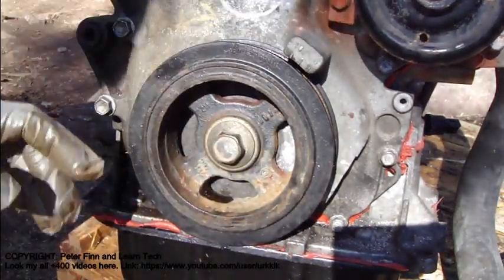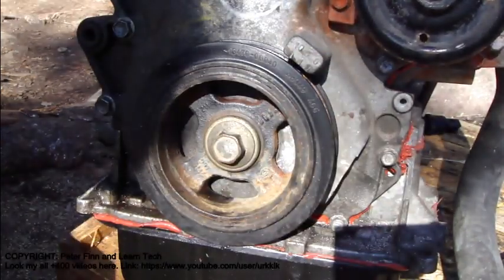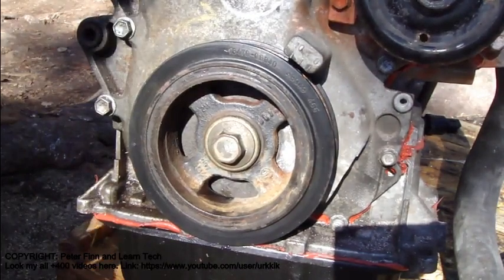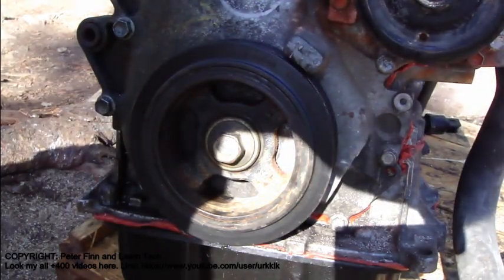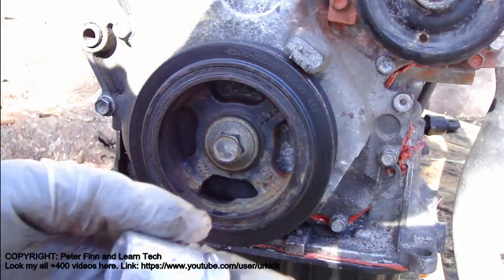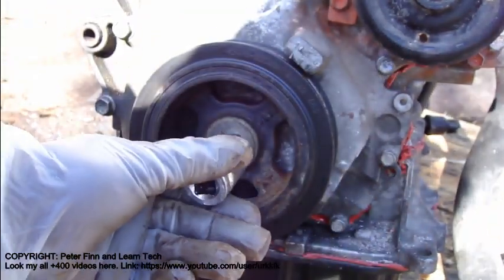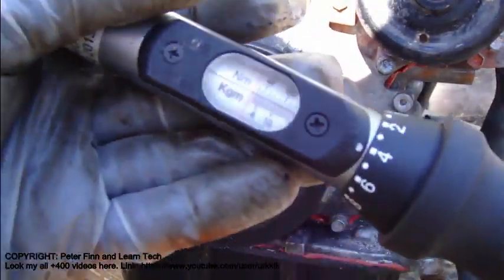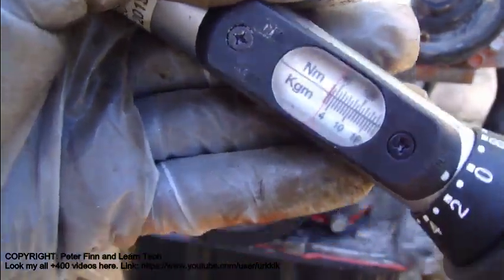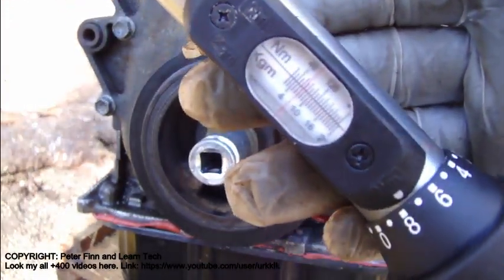And let's see, when I take my torque tool and I clean this, how this happens. Okay, and I clean also these parts, and next I take my tool. Okay, and then we need this 19 millimeter socket what fits in here, 19, and then this torque tool, and I set in here this 150. Notice that this wheel is moving, this line is moving.